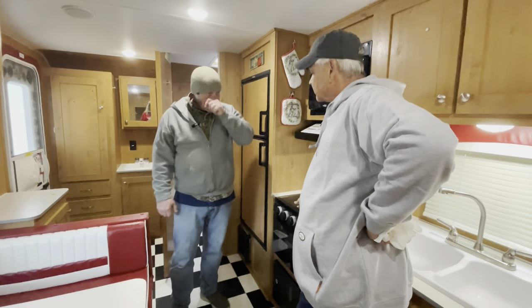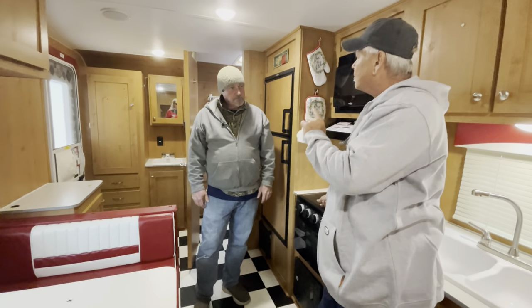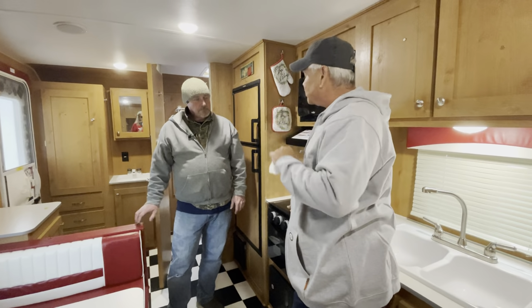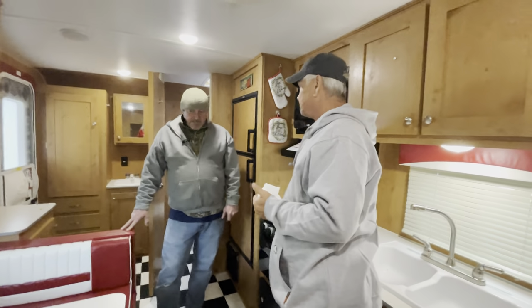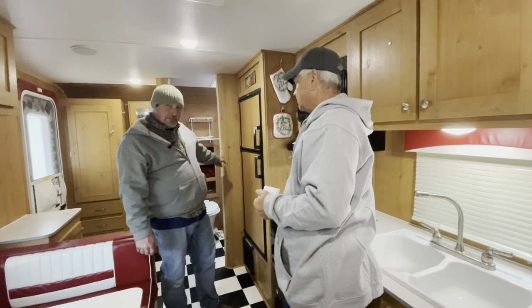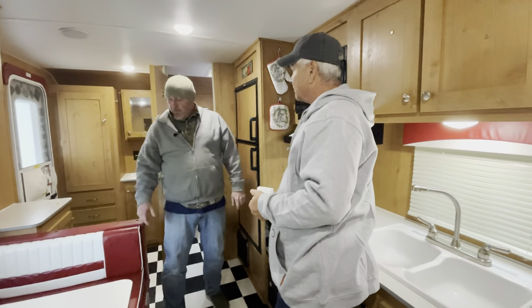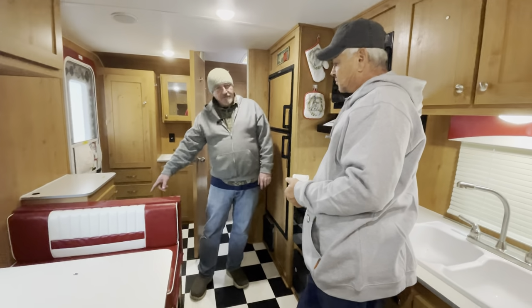Okay, since you mentioned that, we had some floor work done, you guys did. Do y'all know, with a good percentage of certainty, where the water was leaking in from? Yes, it was leaking in from two places, actually. One was the license plate light back here at the back. You showed me that when we first came here. And the other one was this fender well right here. Okay, this back corner, this fender well.